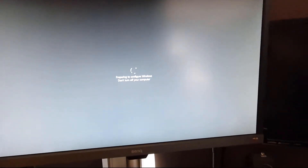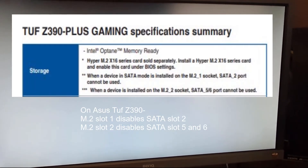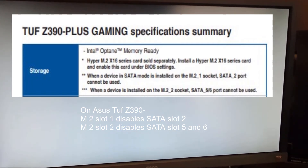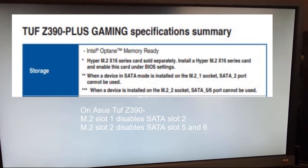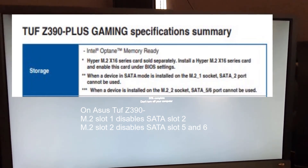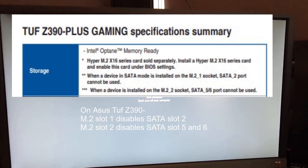As a quick tip: if your computer isn't booting after you've installed the M.2, it's very possible you've got one of those motherboards that disables a SATA drive. If it isn't detecting one of your drives in the BIOS, it probably means that drive got disabled. Good luck — any issues, just let me know.